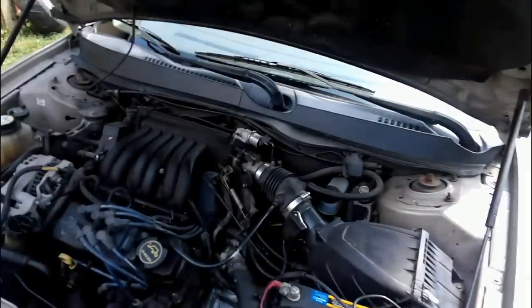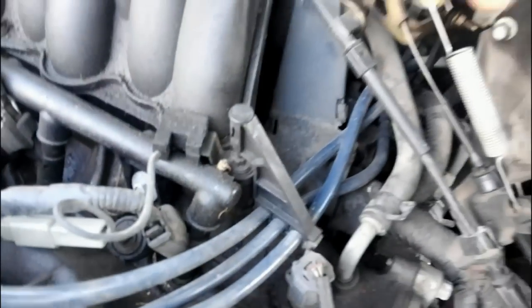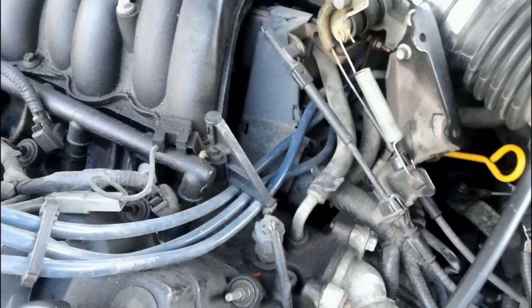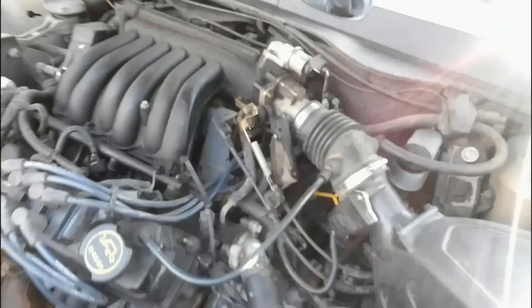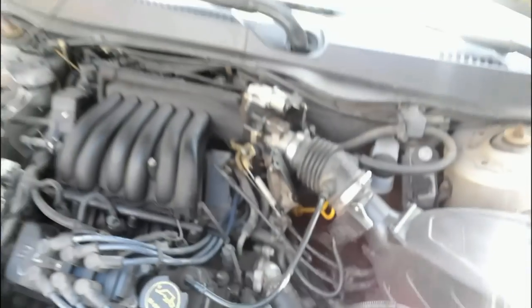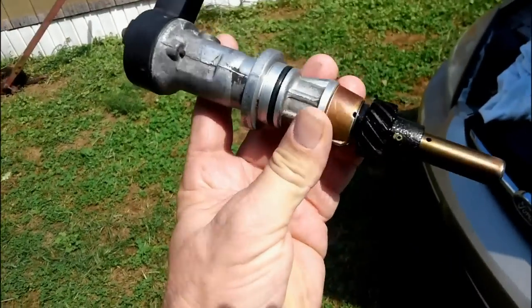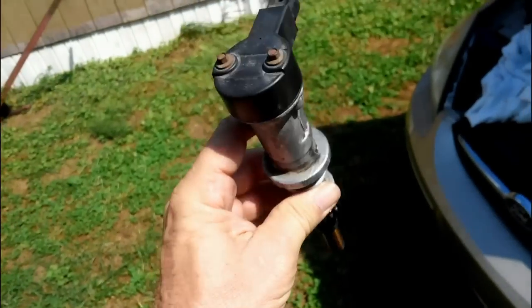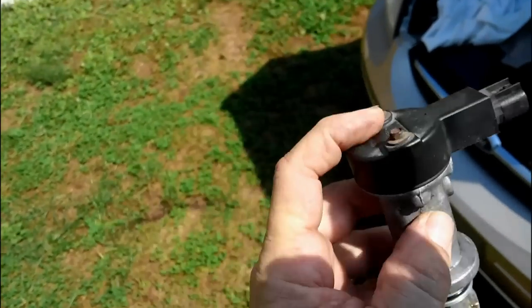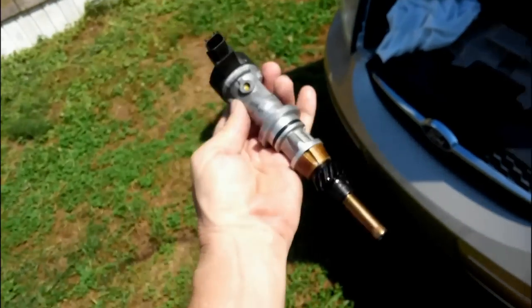It's not near the belt. It turns out it's over here. I did some more research, and what that noise is is something called a cam position sensor synchronizer — basically it's one of these guys. What happens is the bearing inside is getting bad and it's squeaking. This is what it looks like: you've got your cam position sensor that sits up here on top, held on by two little bolts, and this goes down in there — this is what I've got to replace.